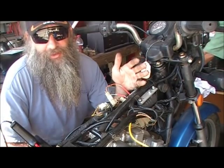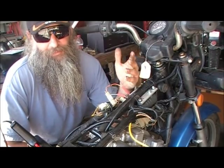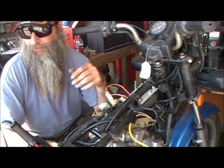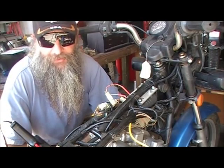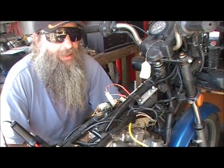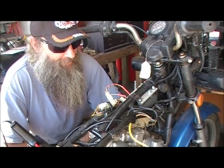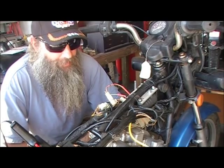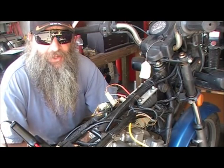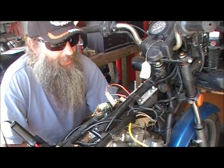The bike will come back — cracked coil, failed windings. You replace them, it's out of your pocket. Half the time the places you buy them from say you gotta send them back to Dyna, and Dyna won't even talk to you about it. It's just a bunch of coils you eat if you're a shop. I've got 10 or 12 sets in a box over there off my personal bikes that I've given a fair chance — and Dyna coils don't last.